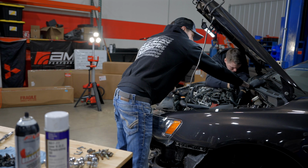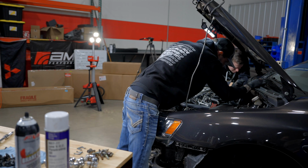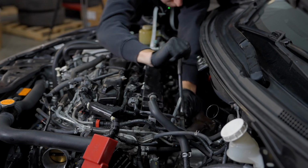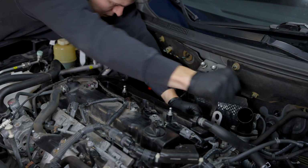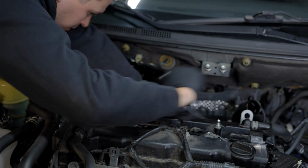When the fastener moves the entire car when you take it off, you know it's tight. Yep, that's a dead giveaway. With a little bit of luck and a healthy amount of penetrating oil, each manifold fastener eventually came off. We also decided to replace all of the headside and manifold to turbo studs with new stuff. It's not something you have to do, but it could save you some headaches down the road.